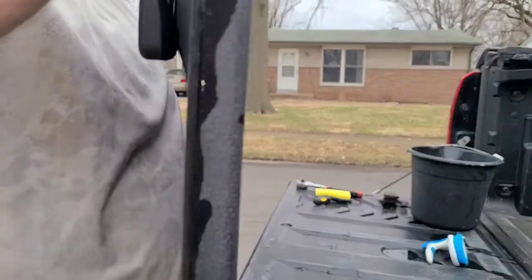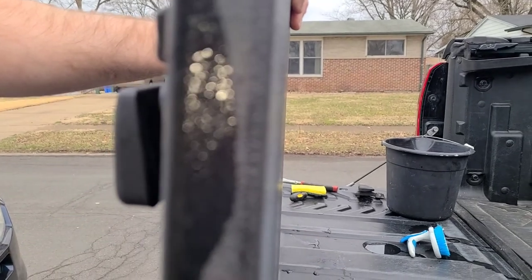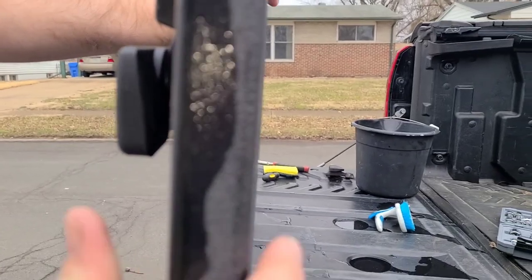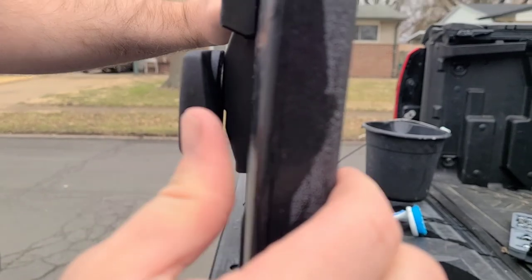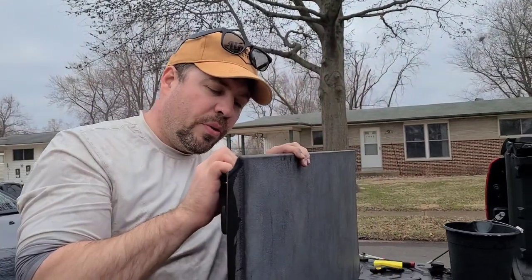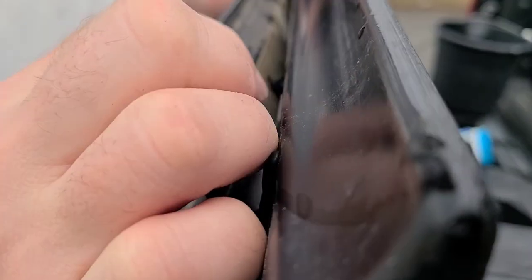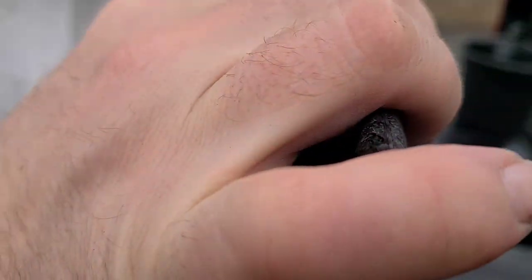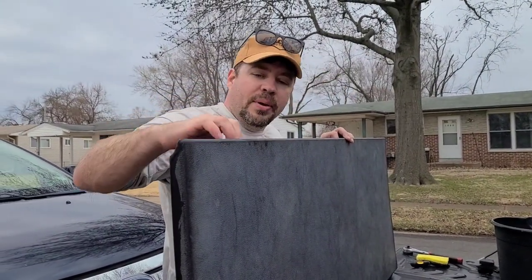Can you see the crack? See the two panels separated? See the split? All that water gets up in there over time. I'm going to drain this all out. There's a line here - I'm going to silicone that. It can still leak from in here because these holes from the plastic go into the same area. If you get a ton of water in there, it leaks. It used to have a tape that sealed it. I'm going to clean here and silicone it solid so the water hits the rubber, hits these, and is supposed to go outside instead of going right through.